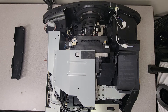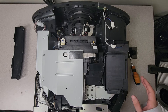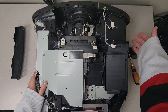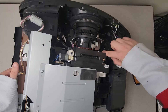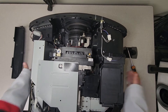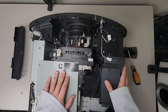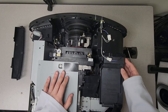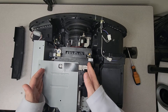These things like to fill up with dust - it's just kind of what they do. So what I'm going to do now is go over some fan locations for you guys, because this is really the big deal here. I showed you how to clean out underneath this - this is actually the fan assembly right here that you can see part of from the bottom. But if you look to the side, there are actually some vents right in here that you can blow out from this side too. Once you have this opened up, you can hit this from both sides and start getting the dust moved out. These are fully enclosed and very hard to open, so I do not recommend trying to get this opened up and pulling all of this out.